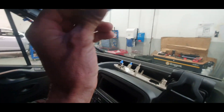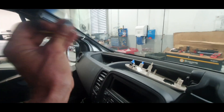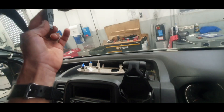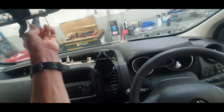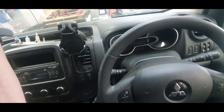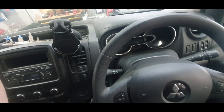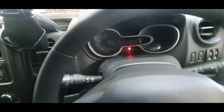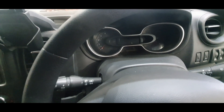This is probably going to be hard to demonstrate, but this is the harness of the pink wire — that's the mirror reconnected. Now watch the instrument display. I'm going to connect this plug... Boom. As soon as that plug's connected, it thinks the back door's open. Disconnected — back door's closed. As you can see, the entire time the back door's closed, the switch is disconnected.